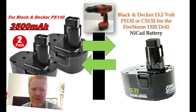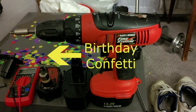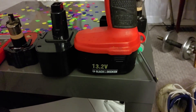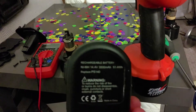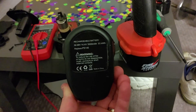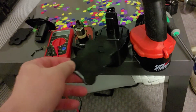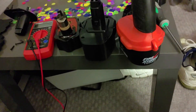I've seen them on sale for like $15 on eBay without batteries. Here's what the FS1320 drill model looks like — you'll notice it has the original 13.2-volt battery pack which almost refuses to take a charge. What we want to replace it with is a battery pack like this, which I ordered for $30 for a pair. They're 14.4-volt battery packs. The only difference inside is that the batteries are a little bit taller, so there's a spacer plate in the 13.2-volt batteries that we're going to remove. There's also an extra wire in there used for the auxiliary light on the 140 model.